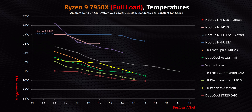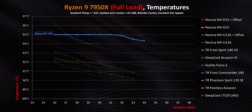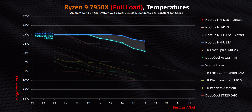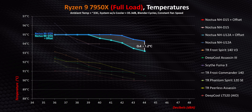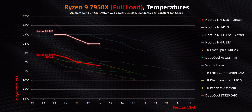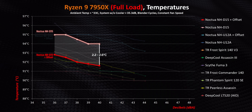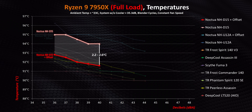Switching to the 7950X — the U12A initially failed to get below 95 degrees until 42 decibels. The offset mount makes a difference from 40 decibels, which is a pretty big improvement, and by the time the dust settled it was a 0.4 to 1.2 degree temperature reduction. The D15 without any modifications didn't do well either, but add those brackets and it's suddenly one of the best air coolers on the planet — heat cut by 2.2 to 2.6 degrees. That really goes to show the D15 still has a ton of potential; it just wasn't designed for modern AM5 CPUs.